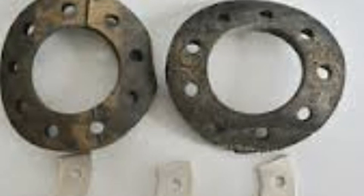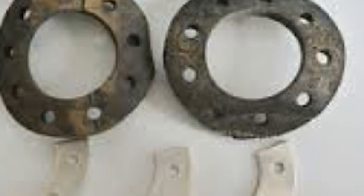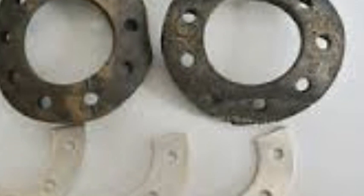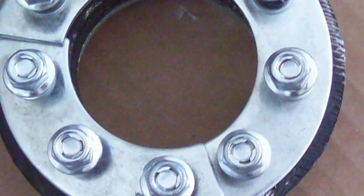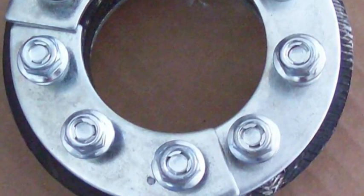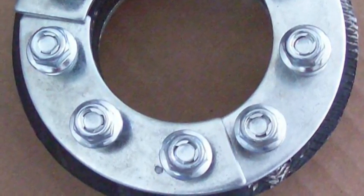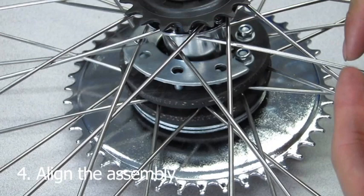Next thing with these kits, whether you do get a two-stroke or four-stroke kit, you get the same cheap parts. This is the main one that drives me up the wall. Two rubber gaskets, a bunch of little metal parts with 8 bolts that you have to sit there and try and line up on your rear wheel on your spokes. Those spokes are not meant to take any pressure, and you are putting a sprocket, clamping it to your spokes, and then putting a 2 to 3 horsepower engine on it, and putting all that stress on the spokes. Not to mention, you don't have any lateral adjustment for your chain alignment. Your chain's not aligned, you're going to wear your chain down, you're going to wear your sprockets down, and if it's off alignment enough, your chain's going to hop off the sprocket, and at 30 miles an hour, you don't have to be an Einstein to figure out that's not going to be a good scenario.